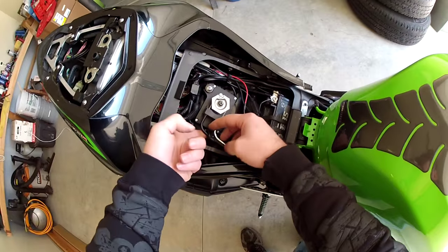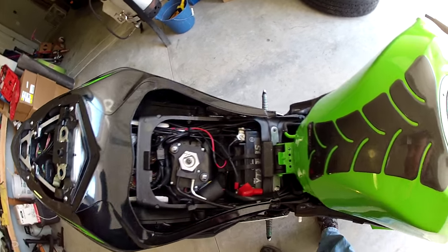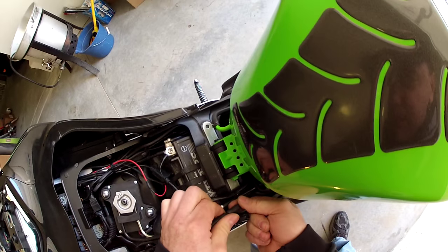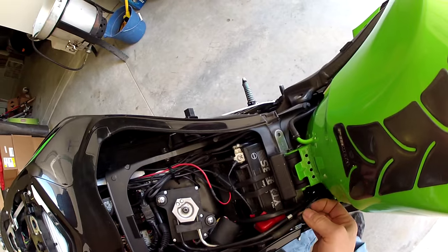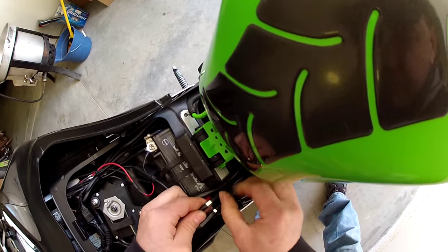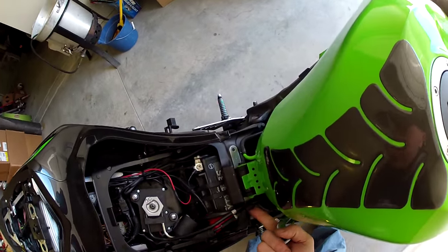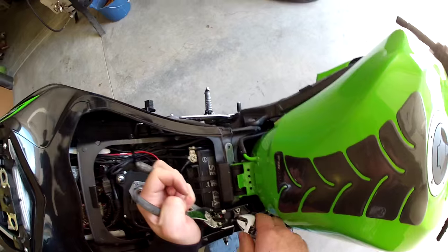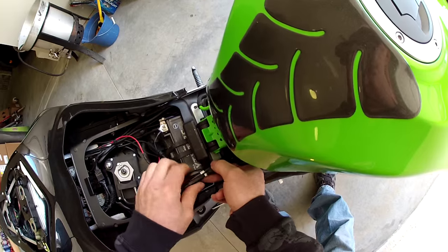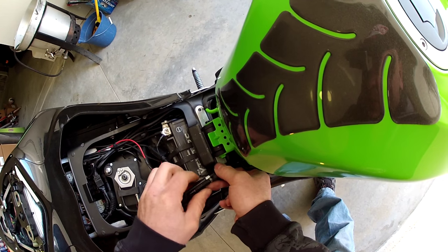One of the first things you're gonna wanna do is remove this wire or cable clamp that just bends out of the way. You can see how these cables route up here, and right inside these little things is your adjuster. So you can adjust the cable slack, which we want to back all the way off. With an adjustable wrench and an 8mm wrench, you can back these cables off. I'm going to use these handy pliers and my adjustable wrench that fits everything, and loosen that up. Screw these together, and that lets you slacken the cable so you can remove it.